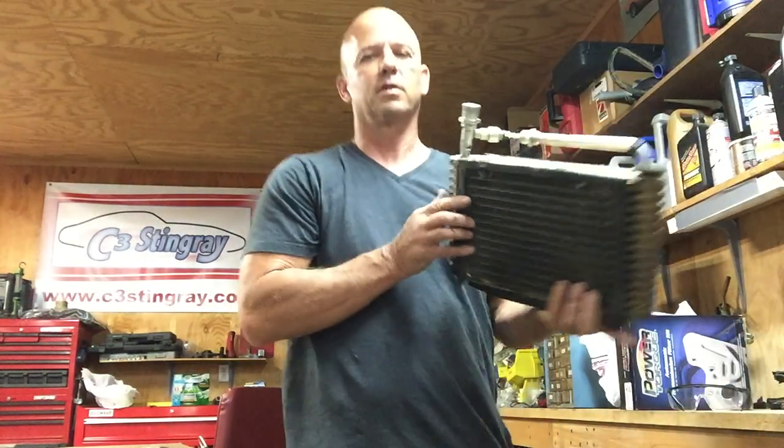And while you're at it, you've got your AC lines off, so just go to the parts store and get some brand new O-rings. They don't cost like $7 for a bag of them. You can replace all your O-rings while you've got everything apart, because you don't want any leaks. And also make sure you replace this orifice tube,